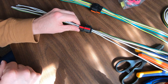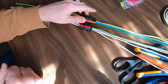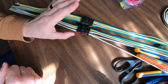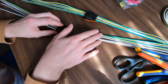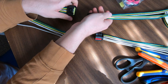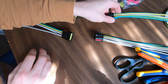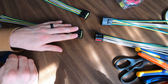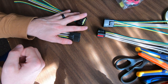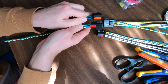Here they are done. I've put some vinyl on them so you know which harness goes where. The colors are not the same, so there's no way to mix these up. You've got your female and male on each side, and I have them opposite — so the only way to mix these up is to actually plug them into each other wrong. This goes to the toggle switch panel; this goes to the car. That's how I deal with those.